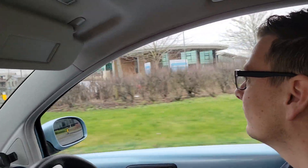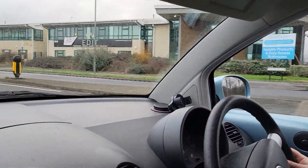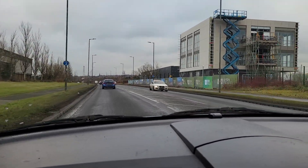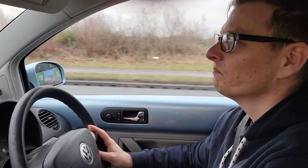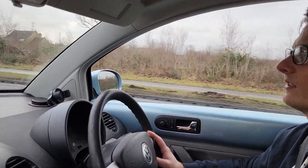So that's about 17 kilowatt hours total — about 55 mile range, probably 60 if I wanted to push it, if you didn't want to make the most of that firmware. Yeah, the inverter gets pretty warm like this as well. We still haven't really cured that. It never cuts out now though. Well, from a dead stop if I just stomp it it still cuts out, but once rolling a little bit I can just bury it.